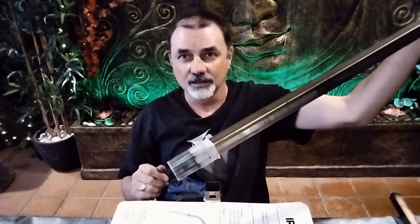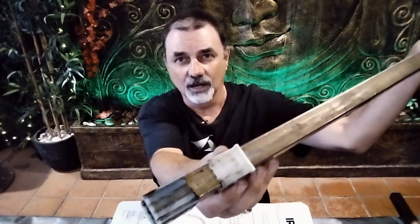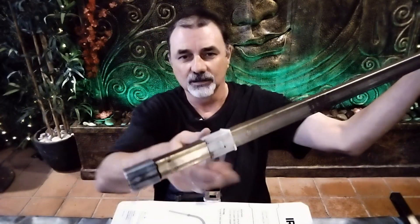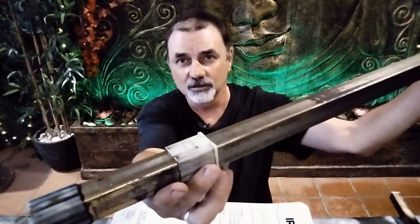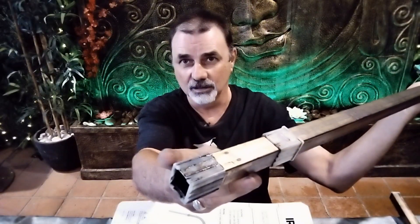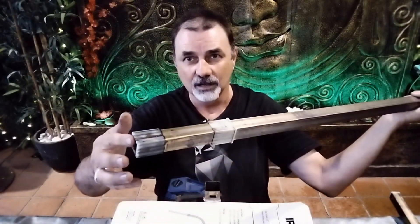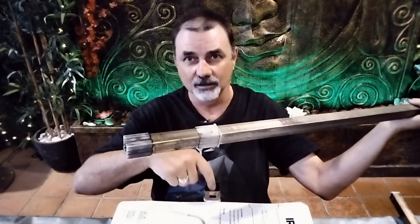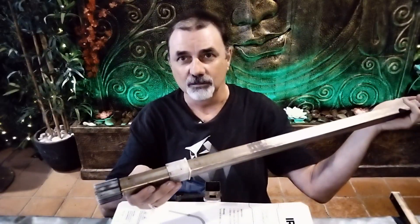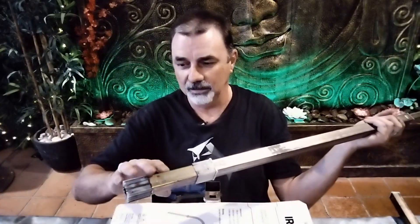As you can see, I believe this is one of the most common failures - the top locator slide which sits on the top of the body has totally come out of that top tube. The other thing that can happen - which happened to me - was this stopper slide on the bottom of the second section actually came off and ended up going all the way down inside the tube inside the van. Those are the two most common failures.